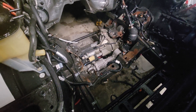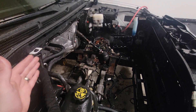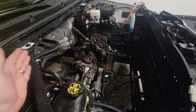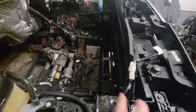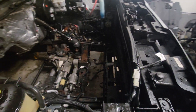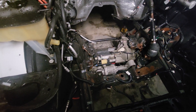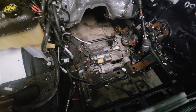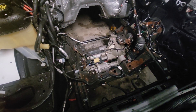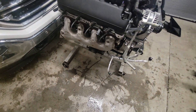I might do something about some of the bare spots on the frame. I ended up taking the whole radiator assembly out plus the crossmember that goes right here — I just didn't have enough room. It's the first time I've ever pulled an engine out of one of these trucks. I was taking the radiator out anyway to put a thicker core radiator in since I'm going to be towing a lot. Everything's gone pretty smooth so far. For being seven years old, I'm still kind of amazed at how brittle the wiring harness loom is — that's again why I bought a new harness for the L8T.